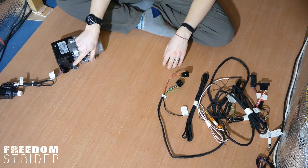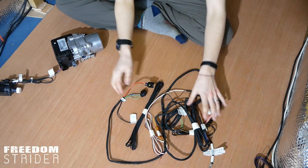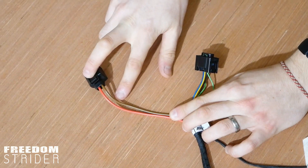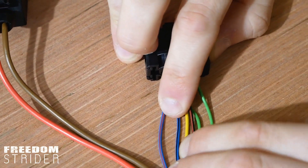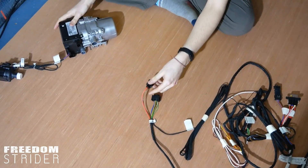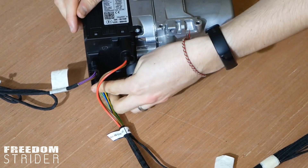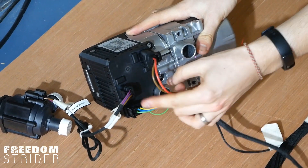The remaining two ports on the furnace connect to one wiring loom. One port has the brown and red cable — that's the power cable. The other has six different colored wires and covers everything else that runs in the heater. We plug the power cable into the top port and the six-wire cable into the bottom port. So that's the three connected: power, glycol pump, and everything else.